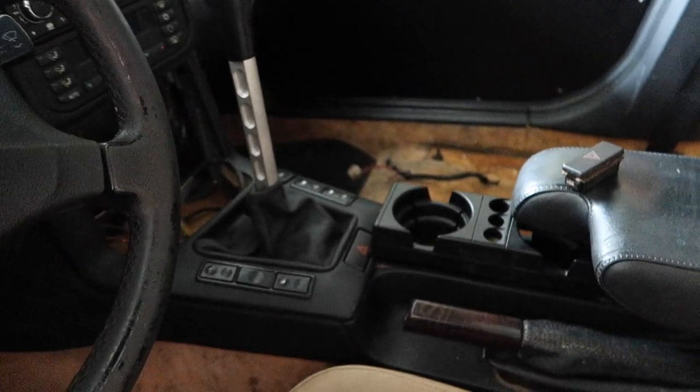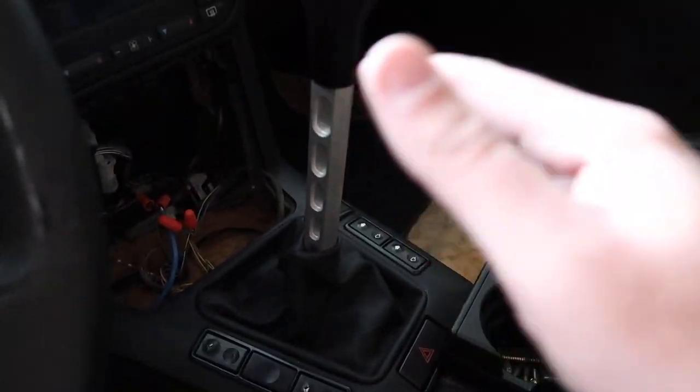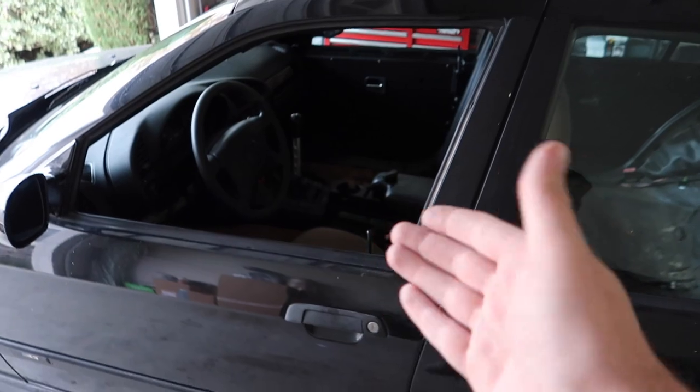Welcome back to another video. Today we're back with the E36 M3, and we're doing something I've been wanting to do for so long. Now that we got the E36 M3 back, it's officially a manual. For those who haven't been following, this was an automatic and we got a Kinematic Speed Shifter. We did a full manual swap — brand new clutch, brand new flywheel, replaced pretty much all the gaskets like the rear main seal, upgraded the clutch lines, clutch pump, and clutch fork. Everything underneath the car in terms of the transmission has been either replaced or upgraded with new parts.